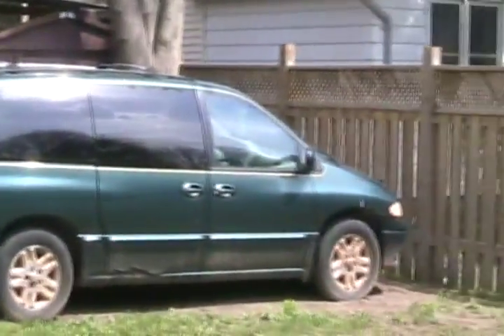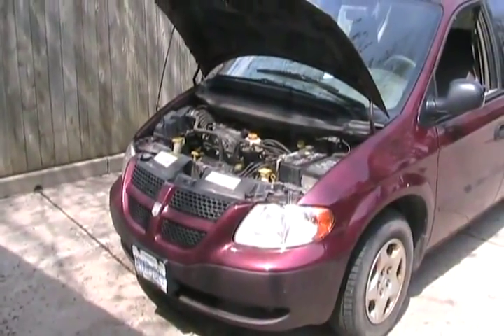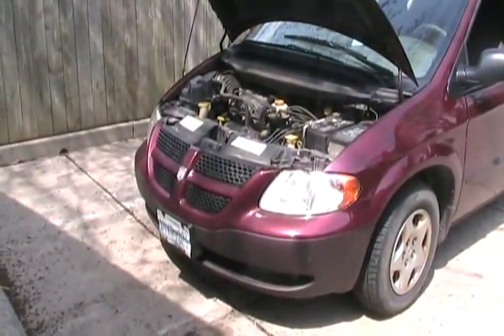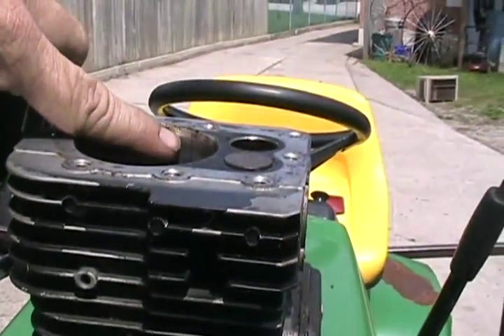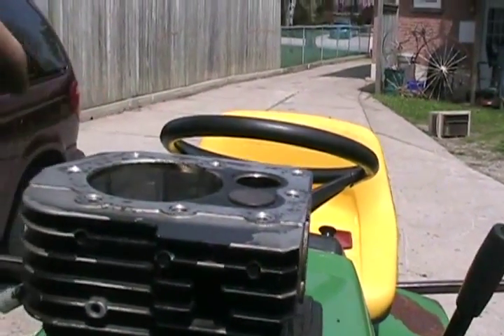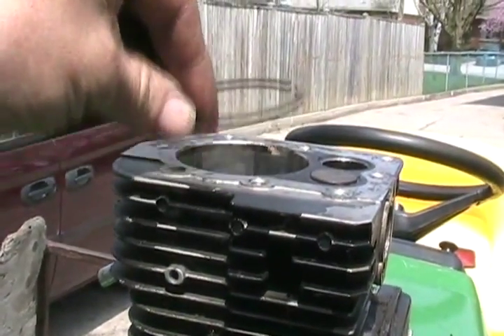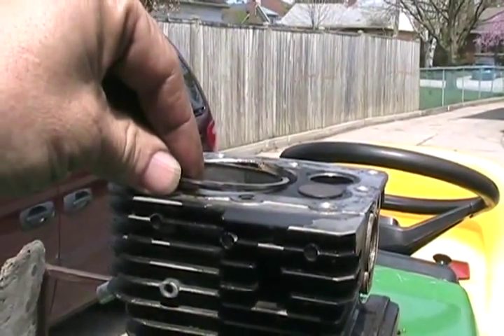It could also be bad rings. The thing that wrecks rings the worst is no air filter on your car, a defective air filter so dust gets in, or extremely overheating your engine at one point in time. Vehicles like that will continuously smoke, and even smoke more when accelerating. Another reason why engines can consume a lot of oil and smoke a lot is broken upper compression rings. On worn and tired engines, every engine forms an unworn ridge — it's worn below, and there's a ridge of unworn material you can feel with your fingernail. That's called the wear ridge. Under normal engine use, the ring just comes up to that wear ridge and stops, and goes back down — no big deal. It's just the way engines wear.